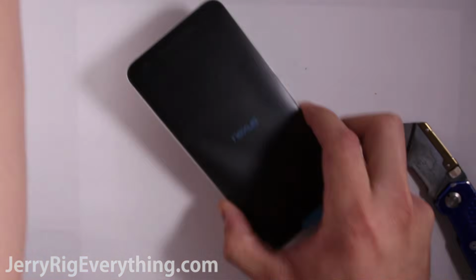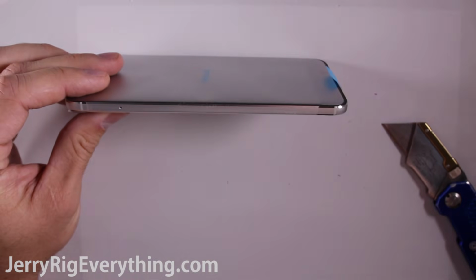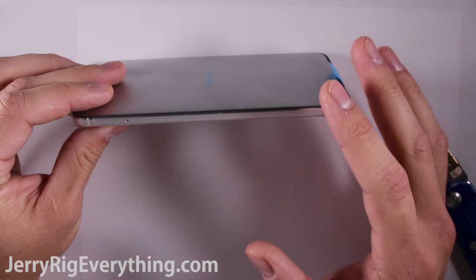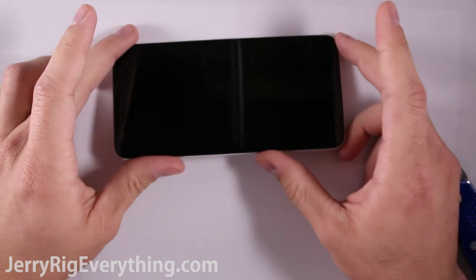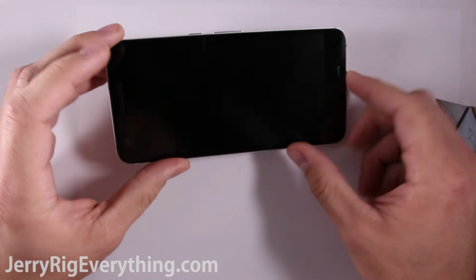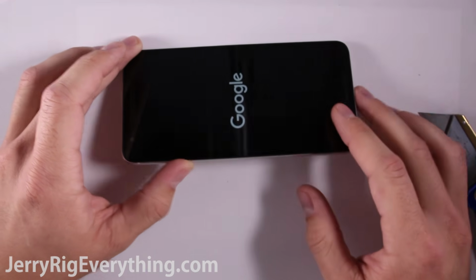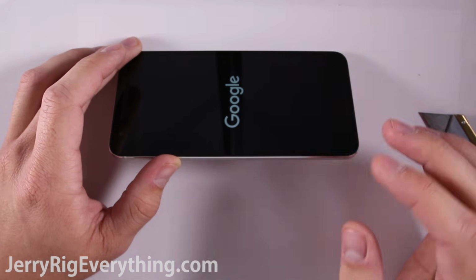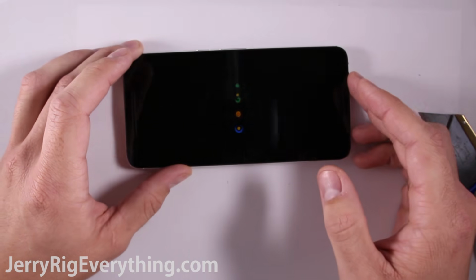So, there are 3 fatal structural flaws in the Nexus 6P. Down here at the bottom of the phone, there is an aluminum midframe inside the phone that is supposed to add rigidity to the device, and it does, kinda. The flaw is that the aluminum frame is not actually screwed in or attached to the back housing of the 6P. They are completely free-floating separate entities, so the aluminum frame is just chilling down there inside of the device. The only thing holding the aluminum midframe to the rear of the phone is a super thin piece of glass on top of the device, right here at the bottom, and a few plastic dovetail joints inside. And even though it is Gorilla Glass 4, the glass is not designed to structurally adhere aluminum chunks together. Luckily, you guys will be able to see the plastic dovetail joints I'm talking about in just a few seconds.